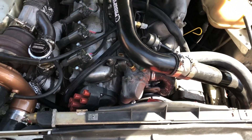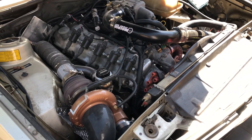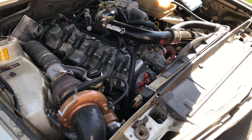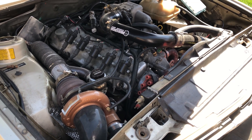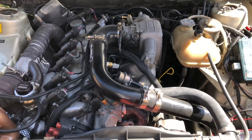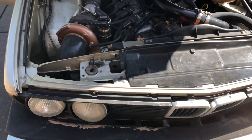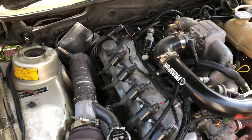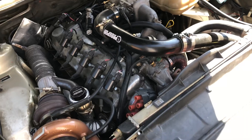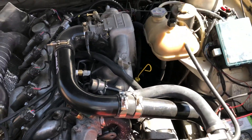It's really a simple setup. I don't know exactly how much I've spent — with the MicroSquirt, turbo, and everything, maybe a little under $2,000. It's a fun car right now, just running 0.5 bar — about 7 to 8 psi — and it pulls really nicely. It's super fun. It's open diff right now so I can spin the tires depending on the surface; especially in rain there's really no traction.